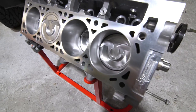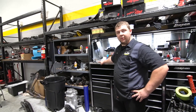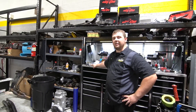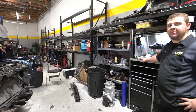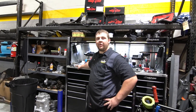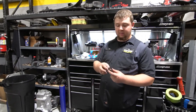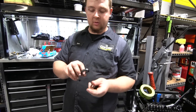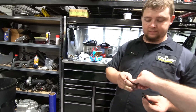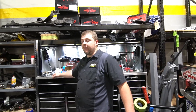Lifters are soaking. This is our first super high mileage LT. How high mileage are we talking? I think it's like at 100 or a little over 100k. Anything crazy going on in there? No, it's just the seals — you normally don't need to replace them, but for example the oil pan ones: they go in the oil pan and the oil pump sits on them. It's supposed to be rubber, but it's not very rubbery. It's supposed to crush and seal — it's just gonna crush, not seal. Like a cover plate.